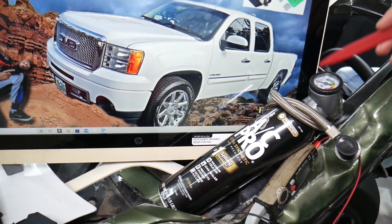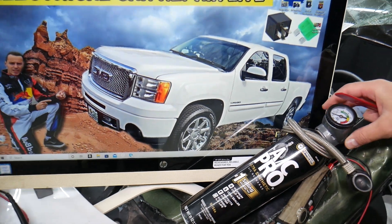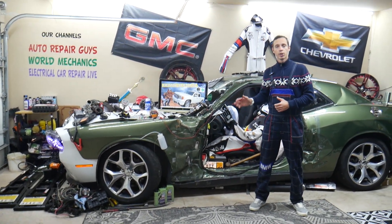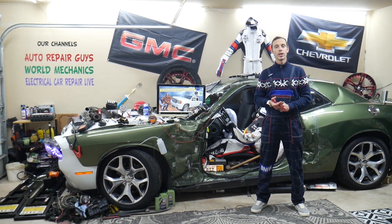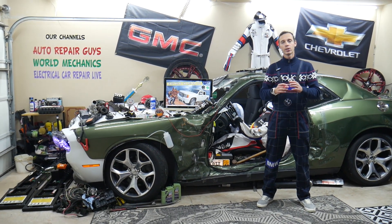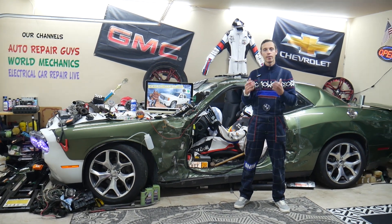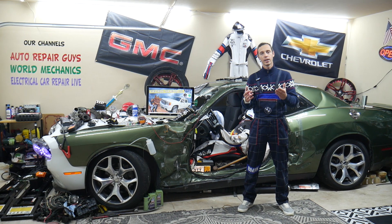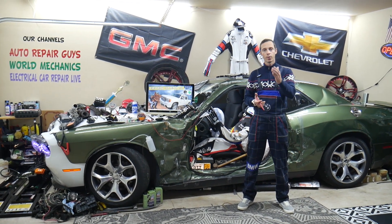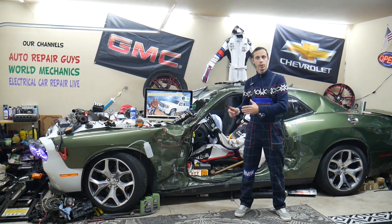Other things that can cause the AC not to work: you need to connect one of the recharging kits with the gauge. If the gauge shows no pressure, that means you have a leak in the system. A leak can be caused by multiple things like a leaking condenser, hose, compressor, or even the AC pressure switch. If you have good pressure but it still doesn't work, it could be a bad AC clutch — we have multiple videos on our channels showing how to test and replace it. It could also be a bad AC compressor. There's also a device installed on the high-pressure AC line known as the AC pressure switch, which detects if you have enough pressure to safely activate the compressor. If it's bad or disconnected, the AC will not work. We have videos on our channel covering the radiator fan fuse and relay locations as well.